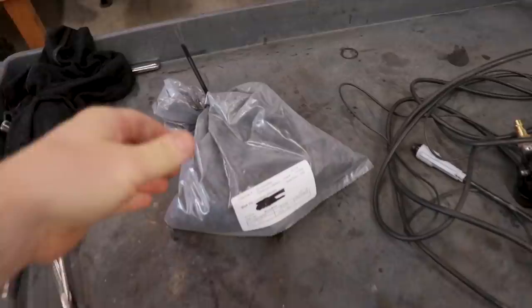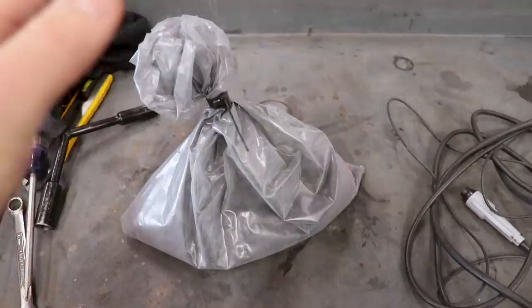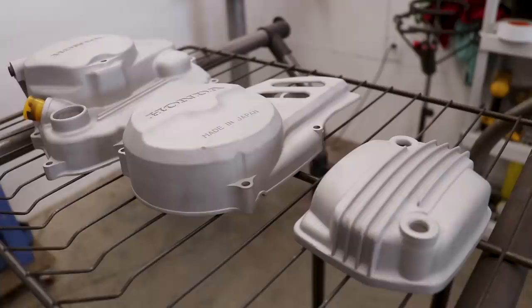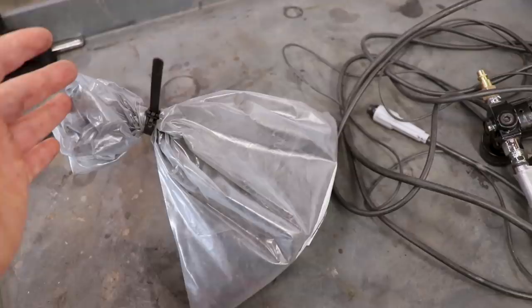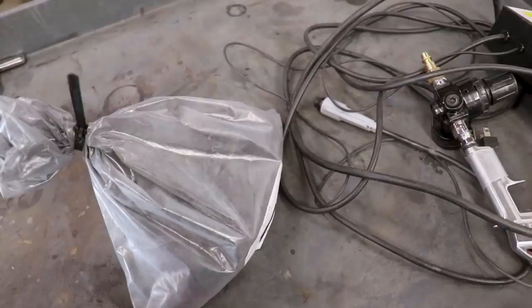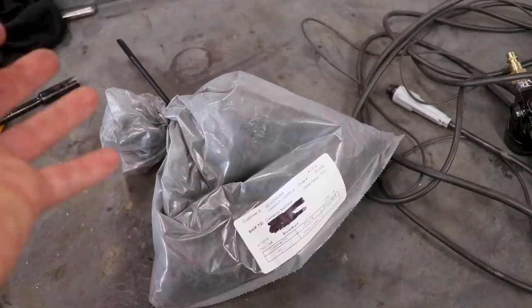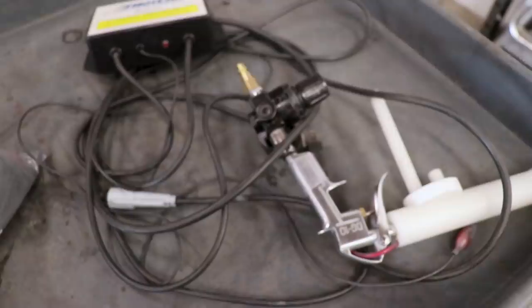Parts are just pulled out of the oven, so we are now ready to spray. As far as powder and color, we'll be going with a Prismatic stone black — this is the same color we used on the rims for the XR80. Here's something to think about: you spend all this time prepping your parts to powder coat them, going through sandblasting, soaking in acetone, preheating, pulling them off the bike — there are a lot of steps. If you go with a powder that isn't quite up to par, all that work is for nothing. My advice: find a powder that sprays out and lays out really good, is super durable, and also fits your budget. I've used powder from Eastwood, Powder by the Pound, and many other companies, and the one I like the most is Prismatic — always sprays out super good, the finish is awesome, and it is durable as heck. I'll drop a link below to where you can find this exact powder.